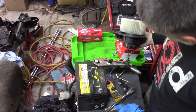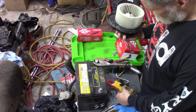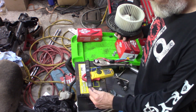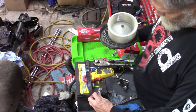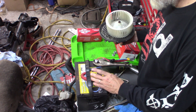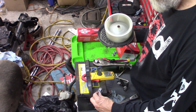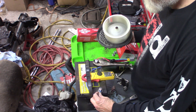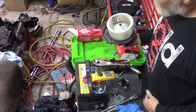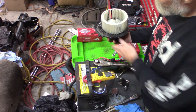I've got the motor out of the car - the fan motor. I've got it directly connected to this 12-volt car battery, and I've got an amp clamp on here to see what kind of amperage it's pulling. The motor is obviously good. Not really showing it pulling much amperage at all - about half an amp, falling. I have an inline 30-amp fuse in case it is bad and wants to blow something. That's the same rating as the circuit in the car. So it needs the module resistor, but the fan motor itself is good.